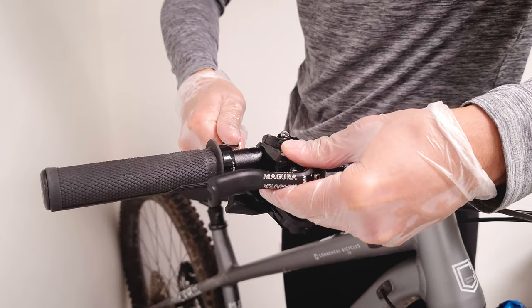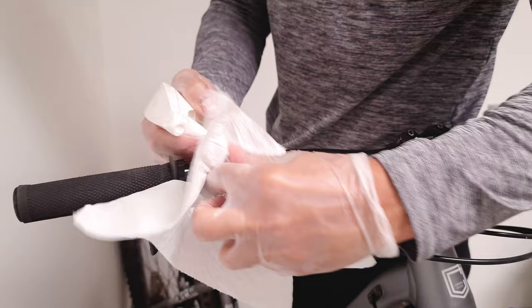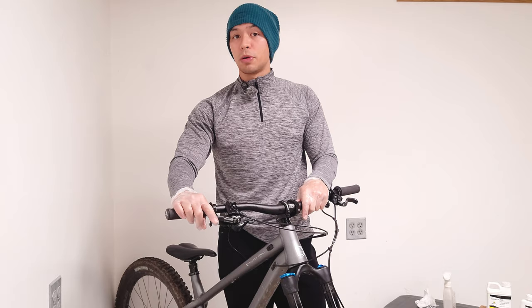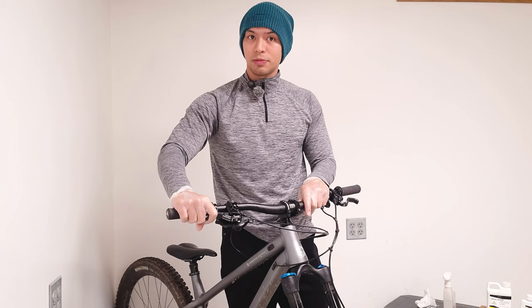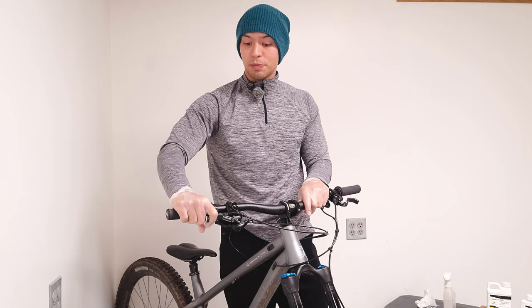You can now reset your lever position and wipe everything down with a paper towel and some alcohol. Now we can test the brakes by giving it a few pulls — you're going to have to pull it a few times just to get the pad to contact with the rotors. After which, give it a few quick pulls to see if the bite point starts going further out. If it does, there's probably still air in the system and you'll have to repeat the process. But if the lever pull is consistent, then you're good to go.